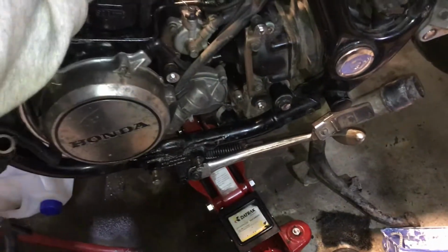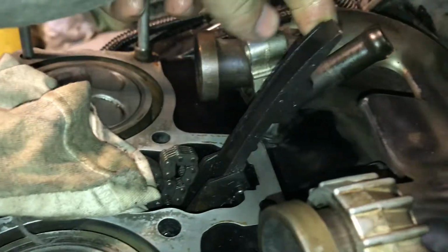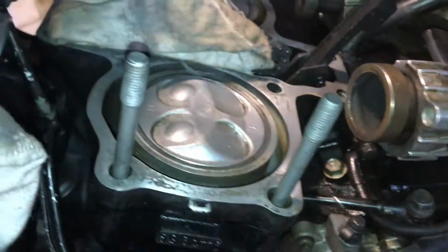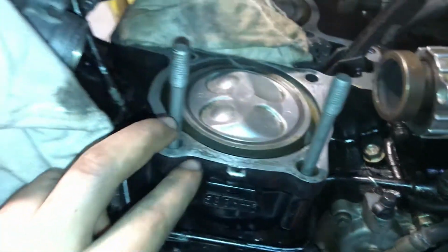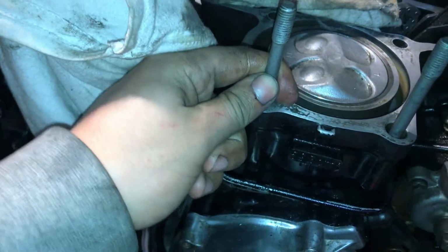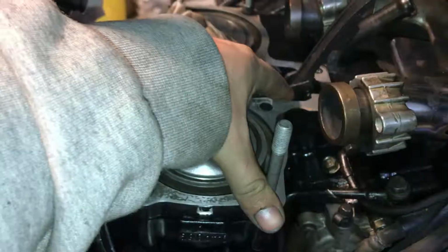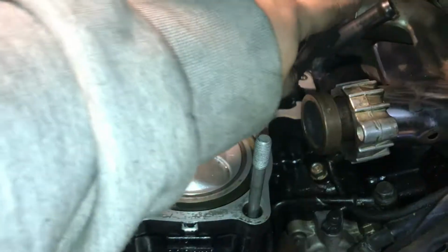and then raise the cylinder head enough so that you can clear these engine bolts as well as this guide. It is fixed in place, so you have to raise up the cylinder head this much in order to clear this guide. I want to mention that it won't work lifting the cylinder head like, I don't know, 1 inch, and with a needle nose plier trying to remove these bolts, because you still have to lift the cylinder head enough to clear the cam chain guide.